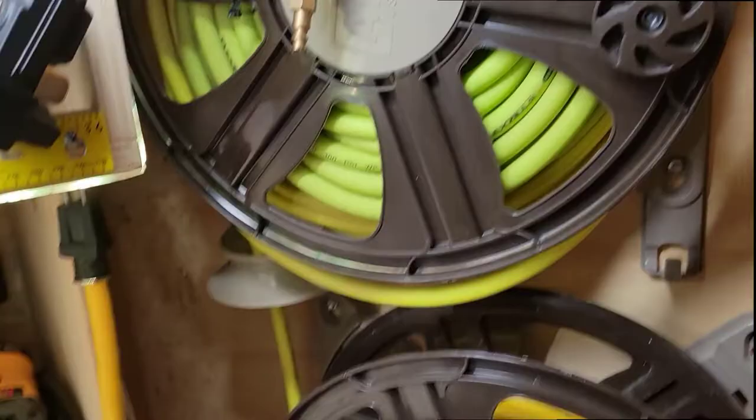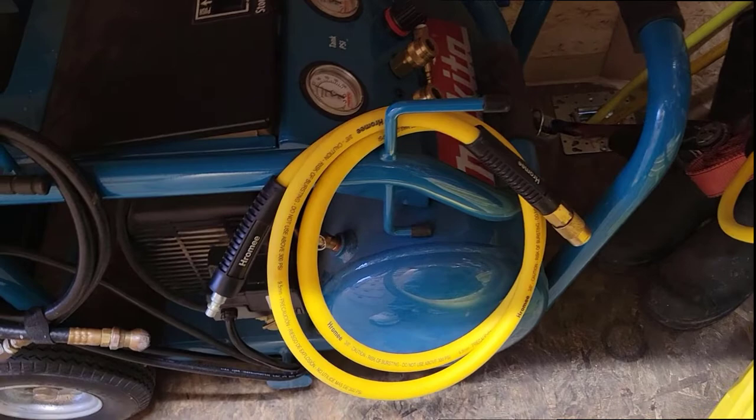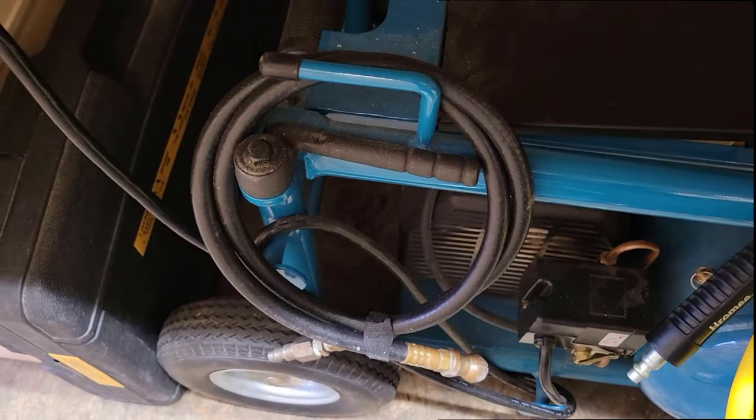For recovery, I just disconnect the pigtail from here and coil it up so I know where it's at. I also have a small extension so I can blow up car tires and similar tasks — it fits on any of my air hoses. I do unplug both the pigtail and my front air from the compressor when not in use, because I've found that if I leave them in, I have some leaky inlets and the system will actually lose air over time. I can't really pin it down, but I think it's the compressor itself.